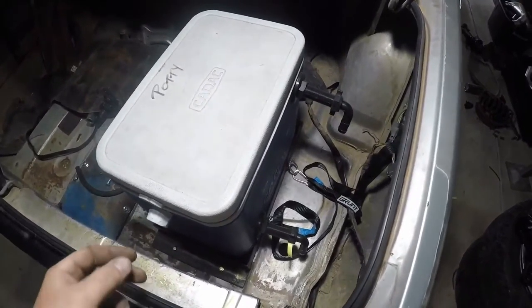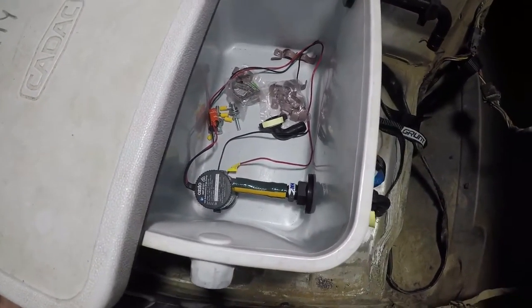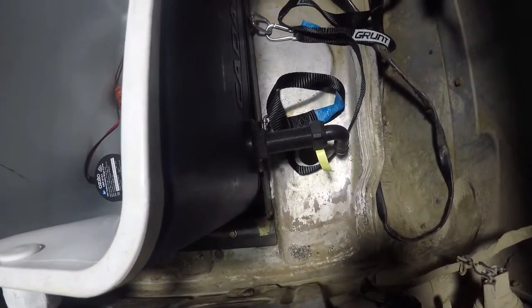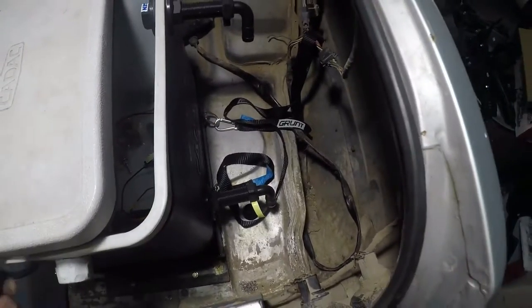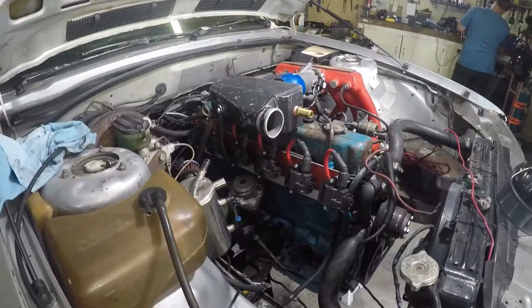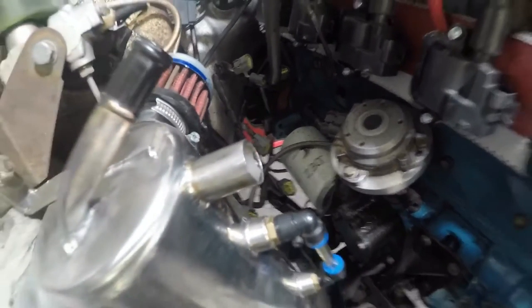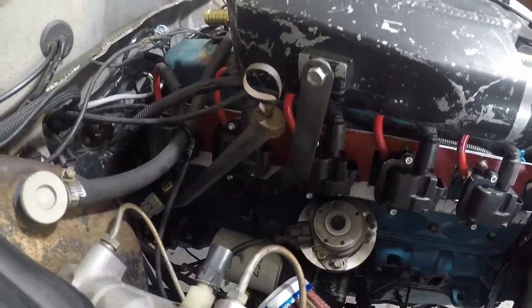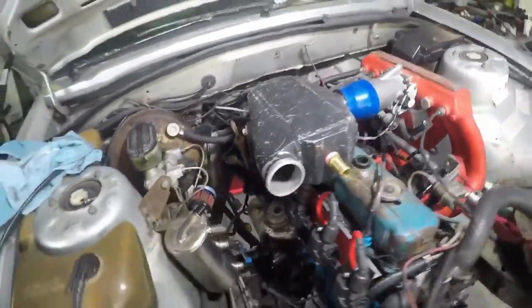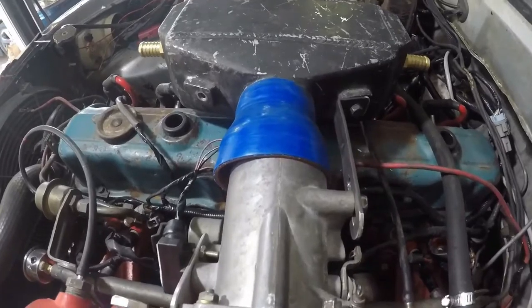In the boot we've got the cooler — a water-air intercooler. There's a little bilge pump in there, should be enough, and it's going to run out through the bulkhead fittings, down underneath the car to the water-air intercooler in the front. The cooler lines will come up with the fuel lines, up into the water-air intercooler which has been mounted off the original coil bracket.